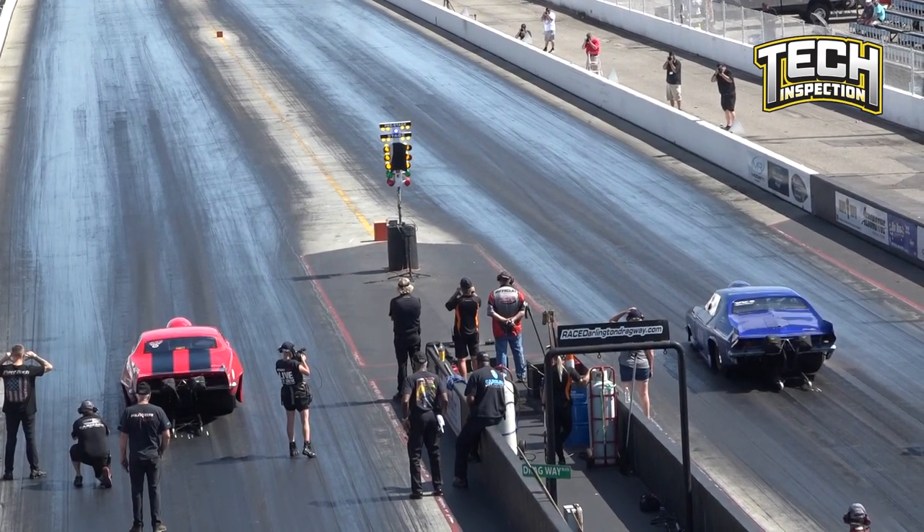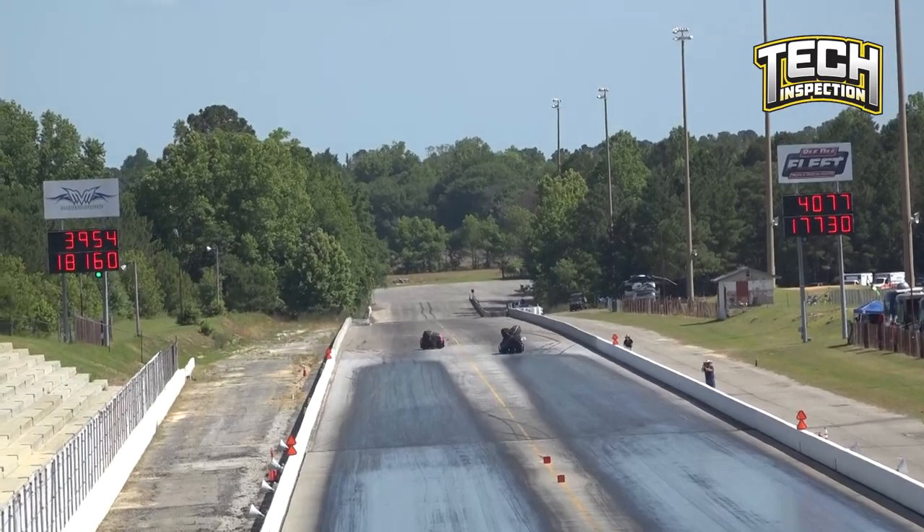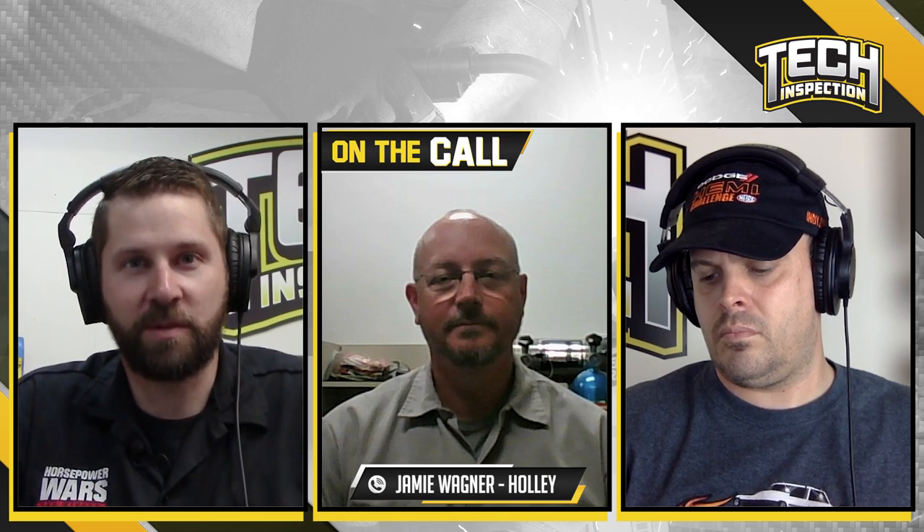We're pretty much at the limits of everything we currently have and are just stacking systems on top of other systems. In pro mods, when I started, three systems running a quarter mile was a big deal. The last time I was dealing with pro mod guys, we were running six systems pretty easily, and some people have run even more testing. Nitrous combinations are generally really big cubic inch — 748 Fulton used to be the deal, then 909 and 959, and now a standard of 1,001 or 1,002 cubic inches. Are we eventually going to run out of displacement for these combinations?